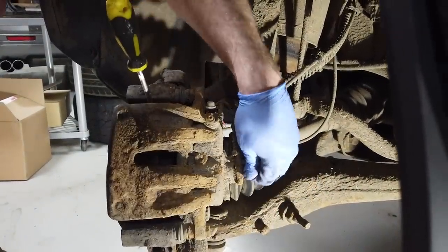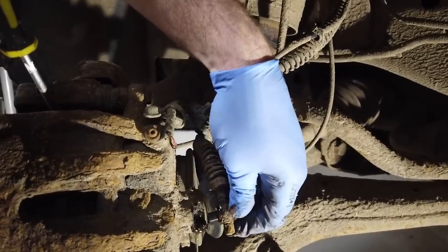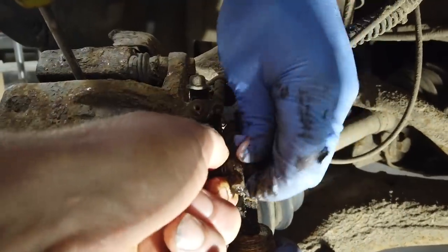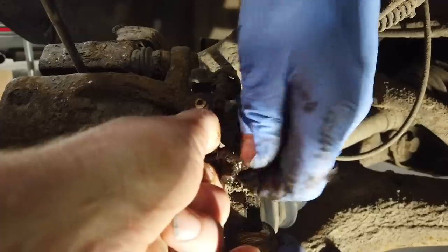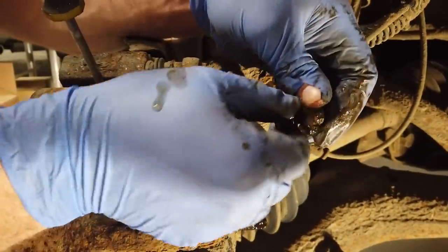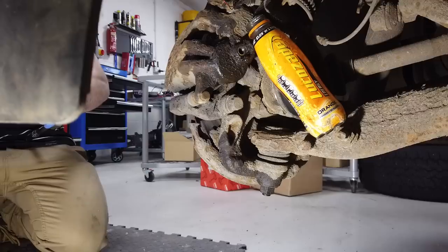Take the bolt out - don't worry about dripping a little bit, I just don't want it gushing everywhere. Can you see that copper washer? Hold the copper washer and unspin the nut. There you go - that's the copper washer off, and then that bolt comes out. Push that bolt and that'll push out that banjo fitting. Actually how many washers has it got - it's got two washers, they doubled up. I've never seen that before. We'll get the pliers on that and get that off.